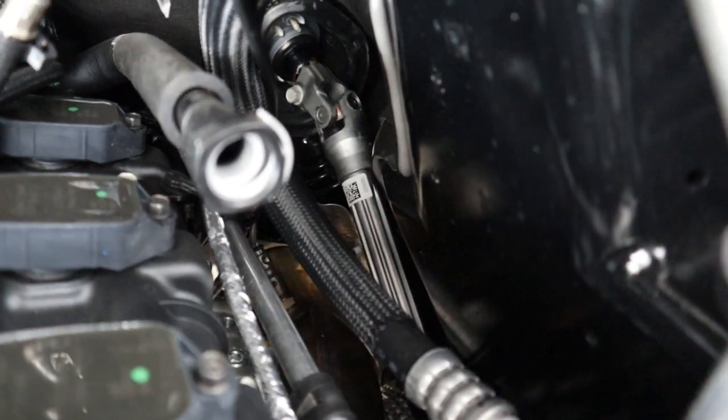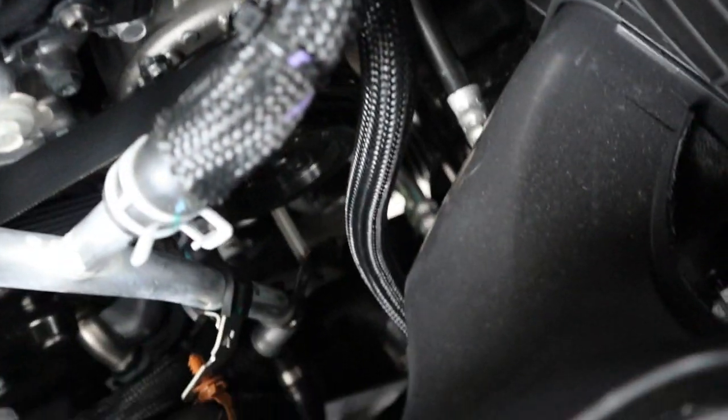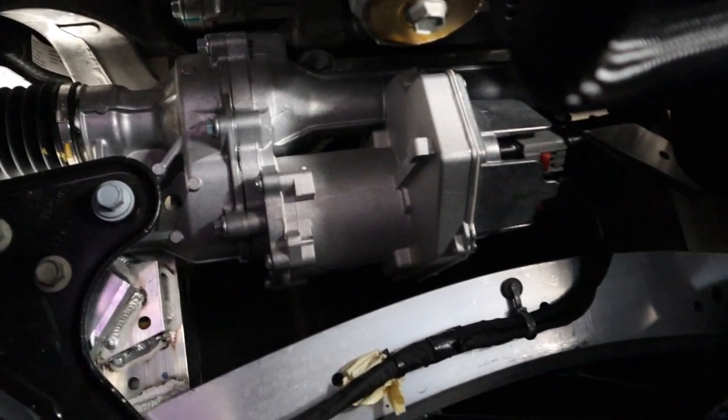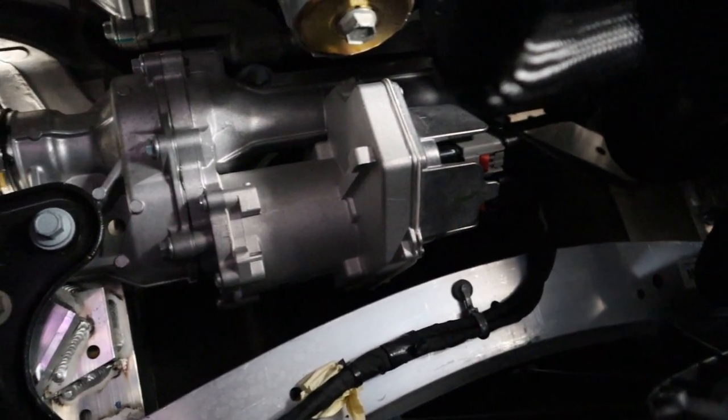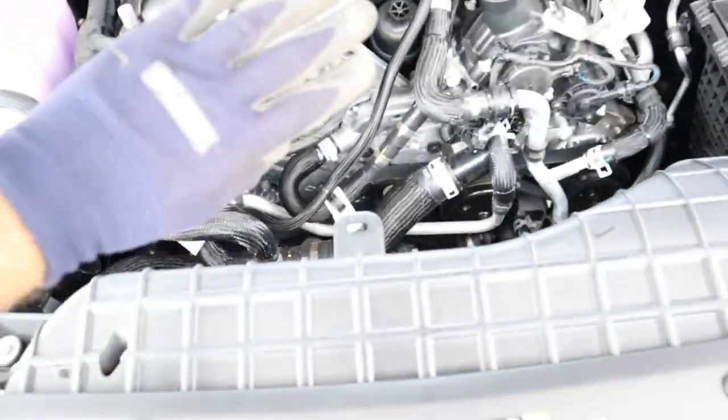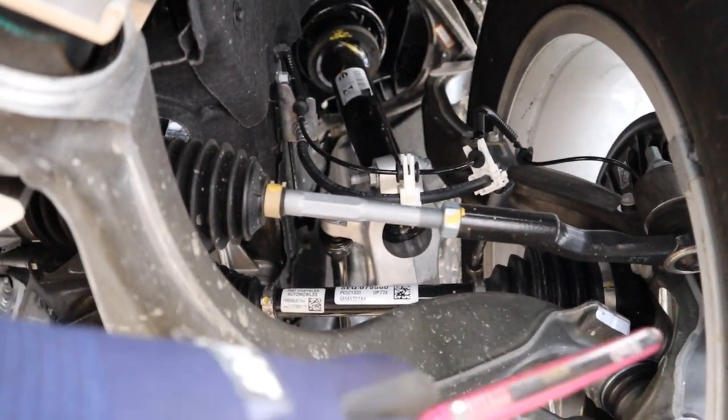Looking at the steering system, there's a really long shaft that comes down to the steering rack located in front of the engine. Here's the electric power steering motor that powers the steering rack — it sits in front of the motor because the motor sits backwards for a rear-wheel drive configuration. Here's the full steering setup with the tie rods going to the steering rack, and you can see the electric power steering motor connections up here — just held together with electrical tape, I'm not sure what they were thinking on that one.